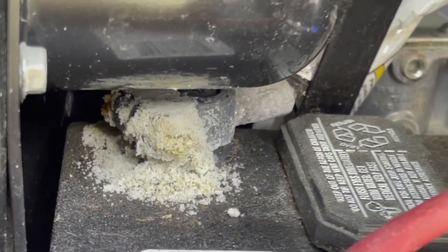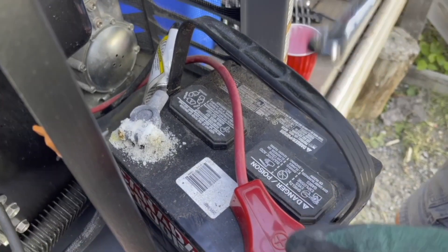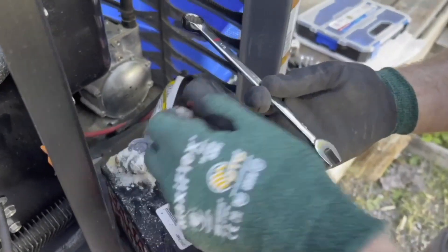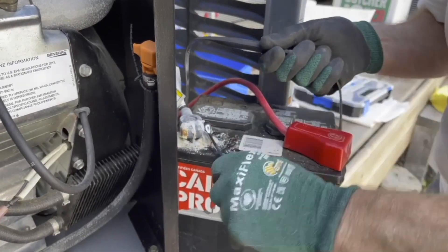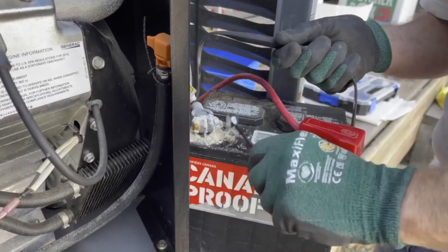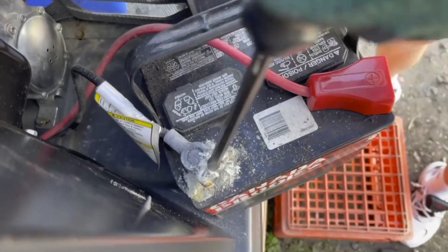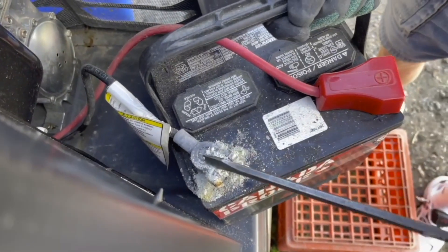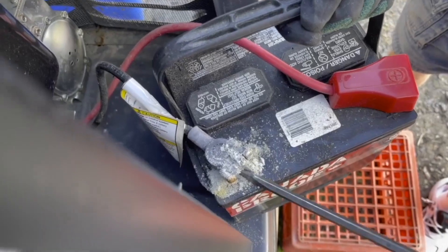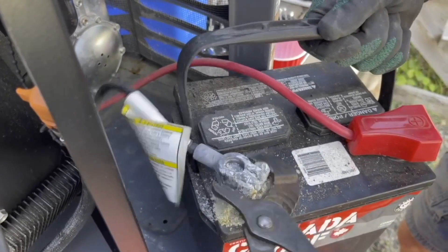As you can see, we were ready for a battery service — that's a lot of deposit on that negative terminal. What I'm going to do is loosen the bolt with a half inch wrench. Even though it will be loosened, it's still going to be sticky, so I'm going to take a screwdriver and try to separate the joint a little bit. This way, when I put my pliers on, I'm not going to be forcing anything. When removing the battery, always remove the negative cable first. This way, if your wrench accidentally hits the frame, you don't create a short circuit.